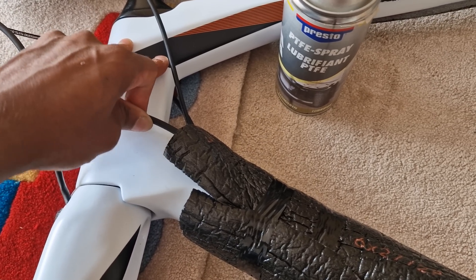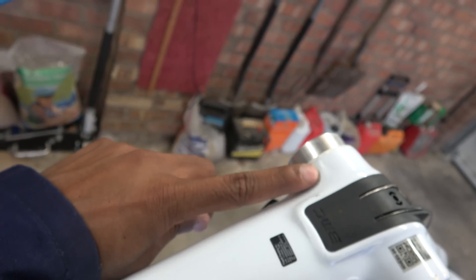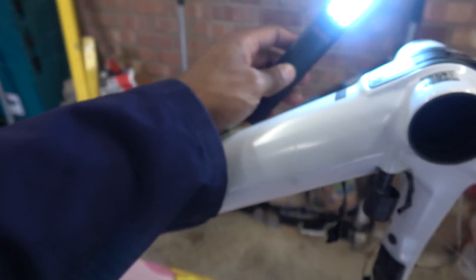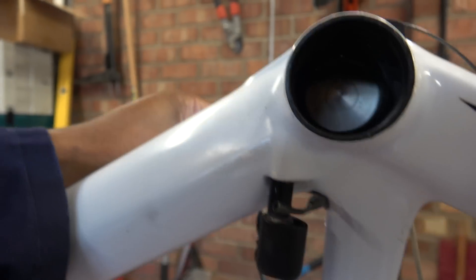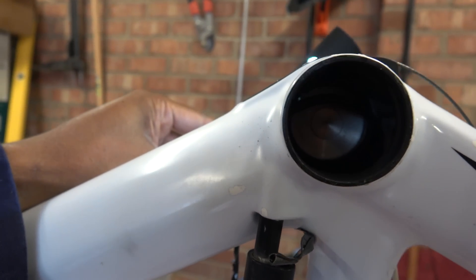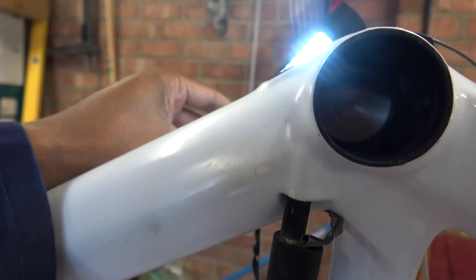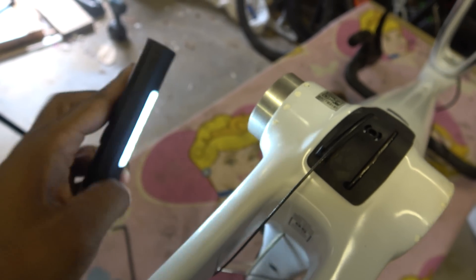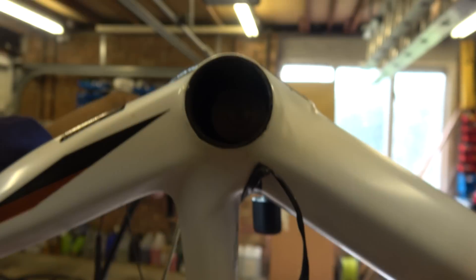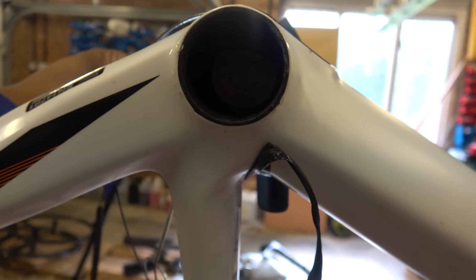We've sprayed some Teflon on it now. That's a fix — a lot better, no creaking. This has been machined: the inside is now 40.95mm and the outside is 41mm, so it's gone in. You can just about see the corners — there are the little bits that were outside of range; I couldn't quite get them all, but you have to draw the line somewhere. This is the drive side, also machined and done. Test gauge reads 41 there, 40.95 — you know the drill. In there — that's a result. Just because it was undersized, we fixed it — a lot lot better.